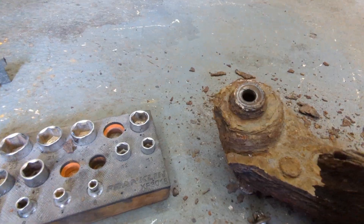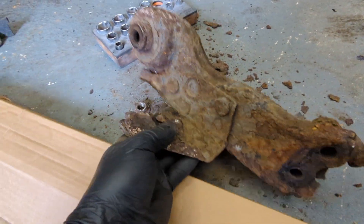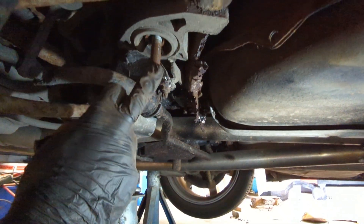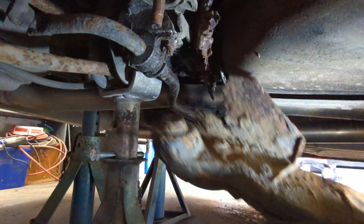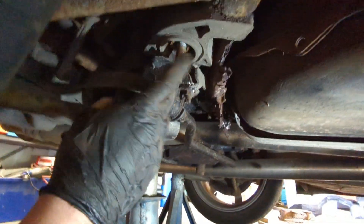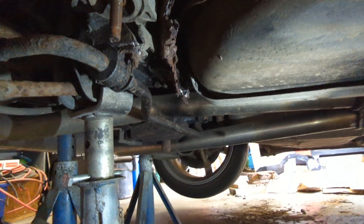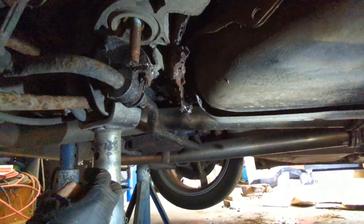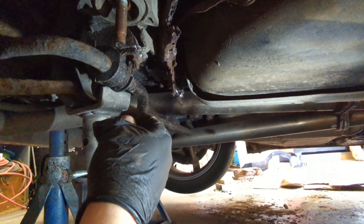This bit is actually attached and it's just broken off. Right, this side is now off - really tight for space but that's it. This stud comes out the floor and holds the subframe, and bolts to the floor. We've got the structural bits off, however this little tie-in brace which holds the handbrake cables is stuck in there. The only way to get that out properly is to take the subframe down, which is a bit of a pig, so I'm going to think outside the box.